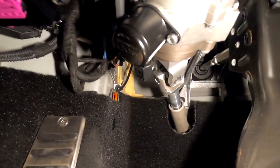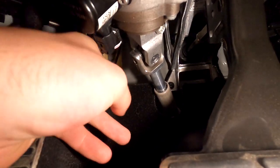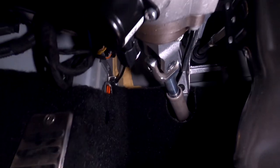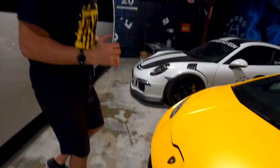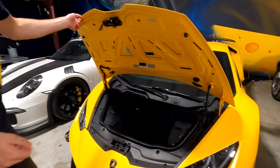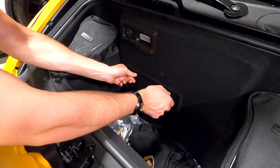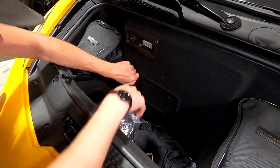So we're going to show you where the manual release is. In the driver's footwell, if we go up here, you'll see this little orange pull tab right here. We simply pull on that and the front trunk opens. You should know how to do this if you're actually doing this on a Huracan. And in here you can see where the trickle charger would plug in — you should have been plugged in.